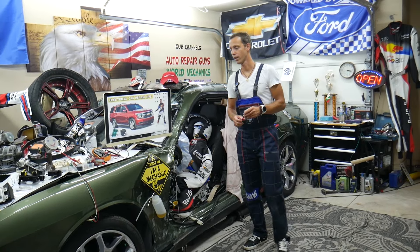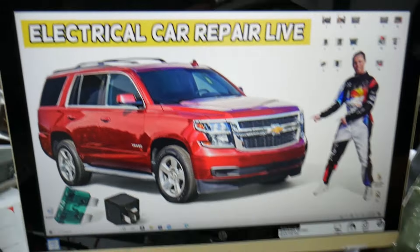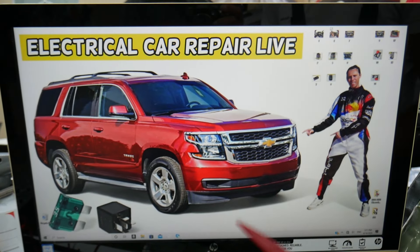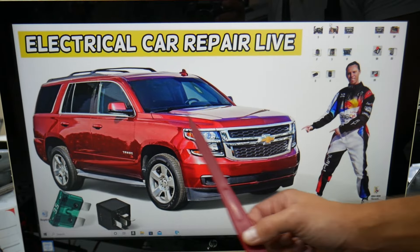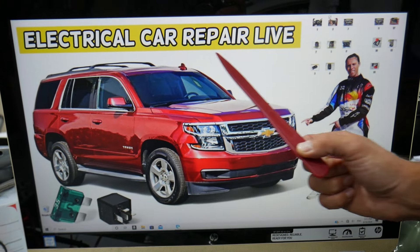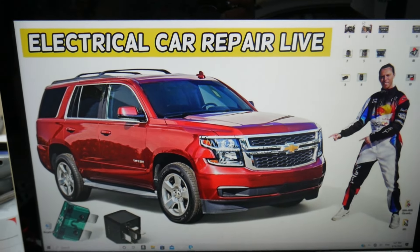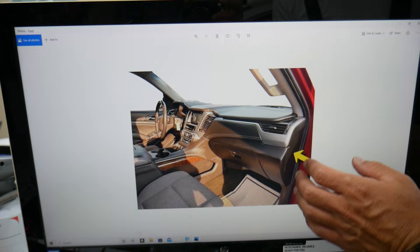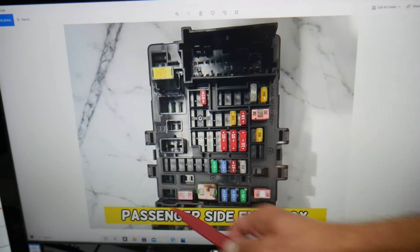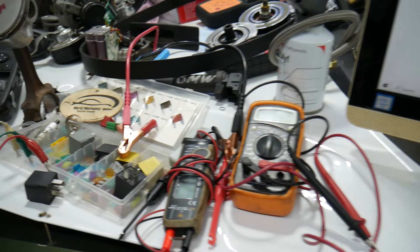The infotainment fuses and relays — where you can expect to find them. We will demonstrate on this generation Chevy Tahoe and Chevy Suburban right here. Both vehicles are built on the same platform; the only difference is that the Suburban is longer, but this should apply to both. Quick reminder: most owners do not know how many different fuse boxes are hidden all over that SUV. We made a helpful video on our YouTube channel about fuse box locations on Chevy Tahoe and Chevy Suburban. Here's what you need to check: open the passenger door, and on the side of the dash you have one cover that needs to be pried open. Once you open that cover, you're going to find a fuse box with a layout like this one here.